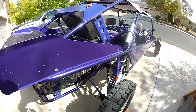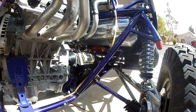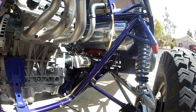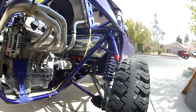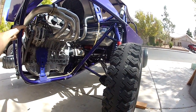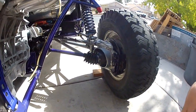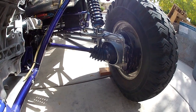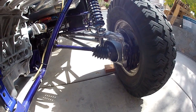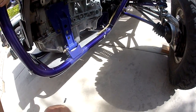In the back there's a Bosch fuel pump with an Aeromotive pre-filter. It has a twenty or fifteen gallon spun aluminum tank. The rear wheels have brakes, and the nine-thirty CVs — I just serviced them last year. I usually do a two-year service interval, so they're good for this year but you'll need to service them after that.